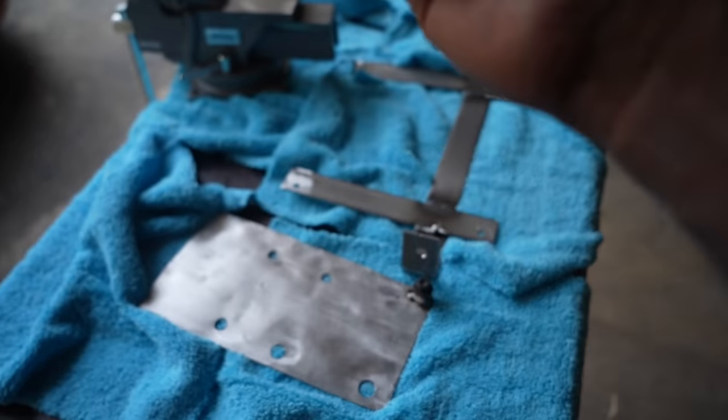And then as you remove that, you see that there is this grommet here. This grommet is actually tapped into the firewall on the passenger side. So what I would advise you is use a pick tool to remove that. All right, so you see where this screw is tapped into. I actually pass it through the foam insulation that is inside the cabin.